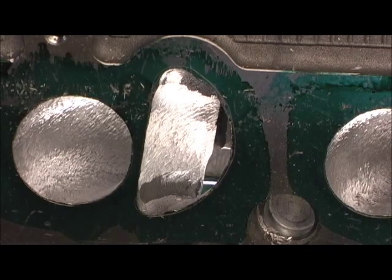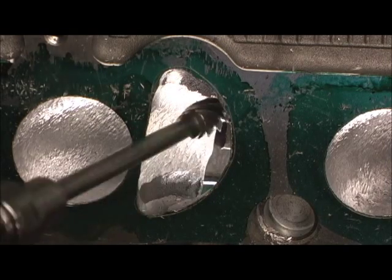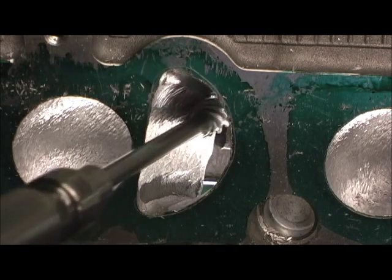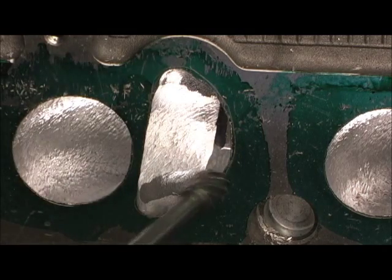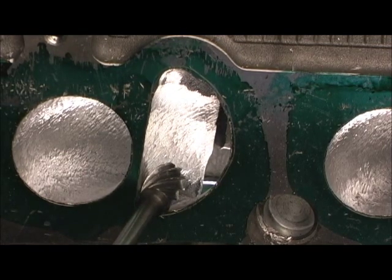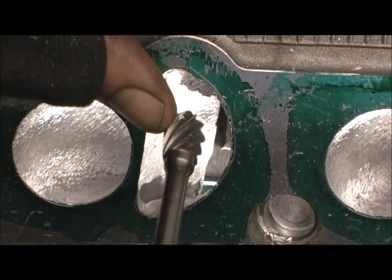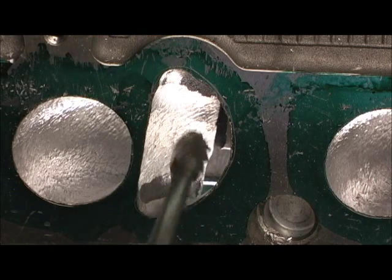Now I'm going for the blending part. All raw material is removed on the exhaust. I moved this side over right here, so now I've got to take a small egg and blend the trenches, pull it in, then shift to the pointed one. I'll form the final shape, get a good blend, do both of them on the exhaust. Basically I'm just leveling because the big cutters leave big marks with their blades that form little baby trenches, and this is going to smooth and blend it out really good.